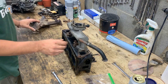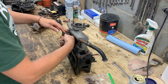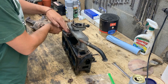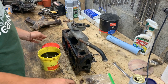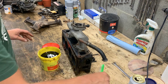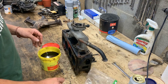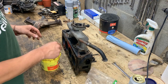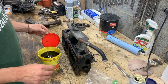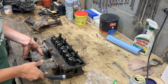If I remove this bolt I'll be able to remove the exhaust manifold and have better access. This was never tight, so I'm pretty sure this engine was running pretty poorly - maybe that's the reason why they parked it and maybe that's the reason why they wanted to sell it. I'm gonna soak these in Evaporust - it's old Evaporust so I don't know how well it's gonna work, but then we're gonna try something else after that. We're gonna use the tumbler with baking soda - I've never tried that before and I haven't seen anybody trying it. I was thinking, since they can do soda blasting instead of sand blasting, why can't I use soda for my tumbler? Here we have two dowels.